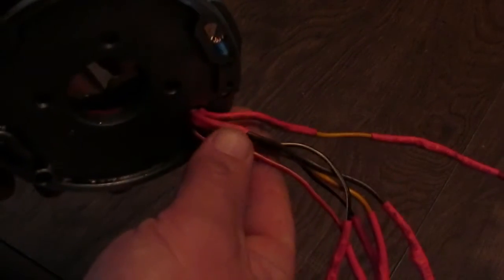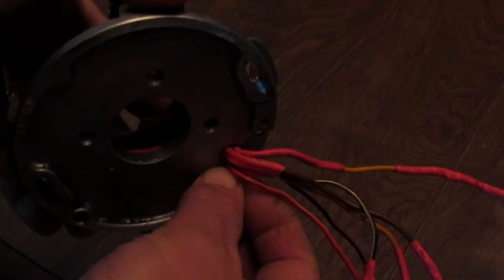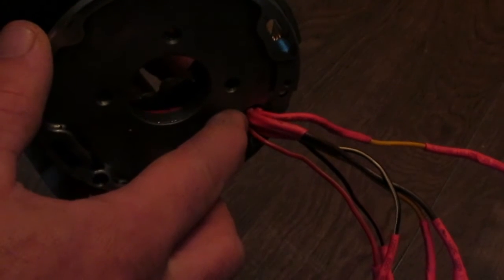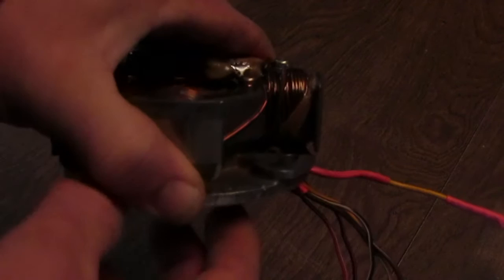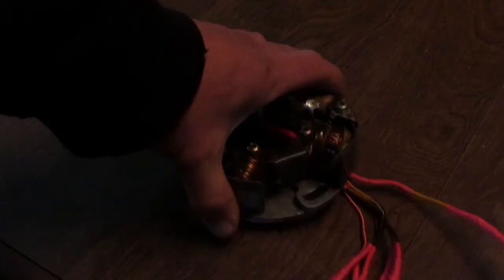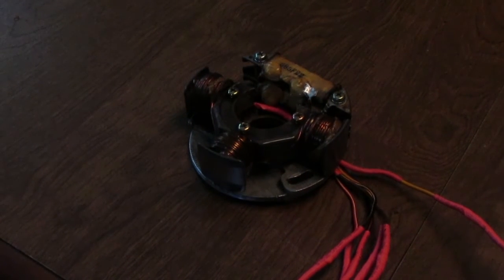What I want is extra protection. You can see I've got heat shrink here and I extended my wires going through that hole. I'm going to strip this down and open that hole up more so that when I heat shrink all these wires I can slip another heat shrink over the top and get through that hole — to guarantee that through engine vibration none of my wires are going to fray and short to ground. This hole is really too small for all these wires to come through comfortably. One of the yellow wires on the stator coil had a nick in it, which I fixed with electrical tape and heat shrink.